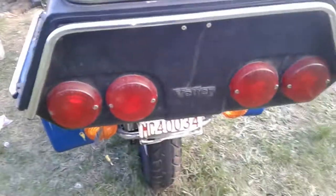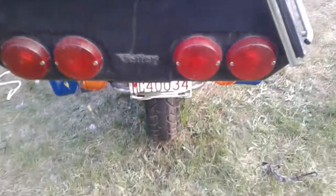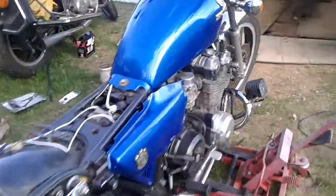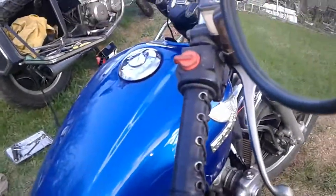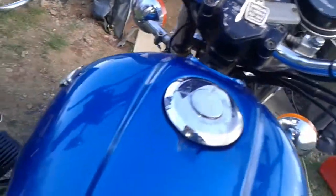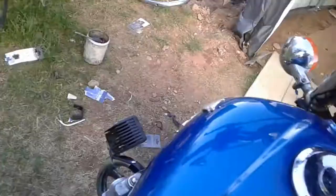Put the trunk on off the other bike. Haven't got the lights wired in yet — I'll try and do that tomorrow before I go to the gym and work. I can get in Majorville now. Adjusted the timing chains up because there was a rattle in the motor — there ain't no more rattle. Cold-blooded.